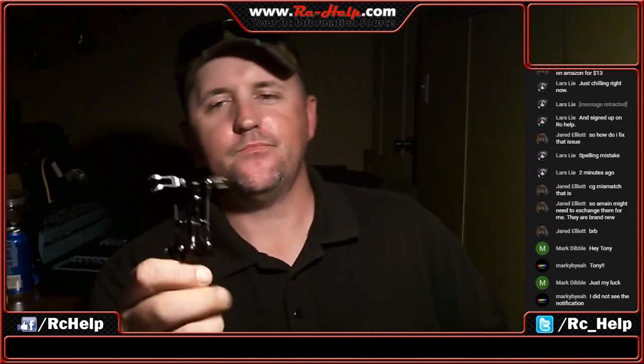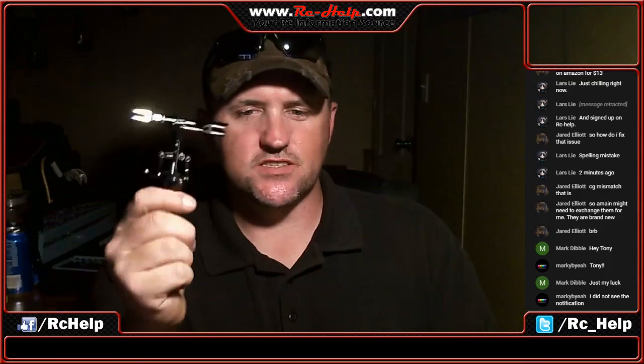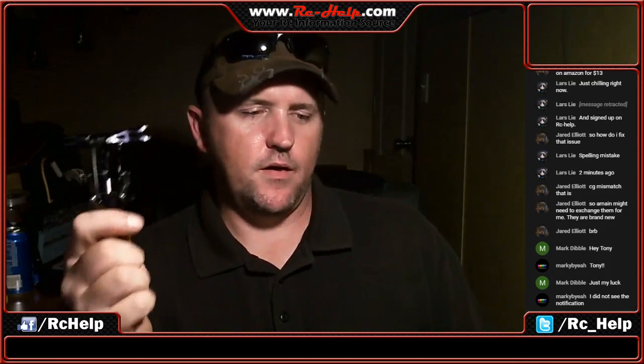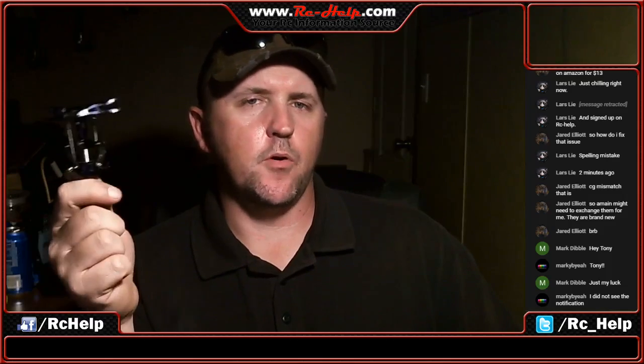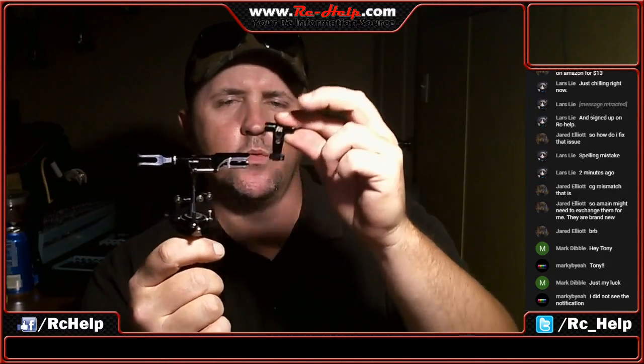Just your luck. No, what we did in this one, and I'll recap for everybody. We had this head, the head off of the ALZRC 450. And something was bugging me about it. Like I said, I was losing sleep over this damn thing. So I had an old Hobby King flybarless head that was just like this in a box. I went and grabbed it to compare it and put them side by side. And I noticed that the hole that holds the head block to the main shaft was 8 millimeters higher on this one than it was on this one.